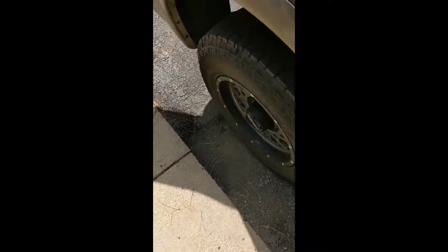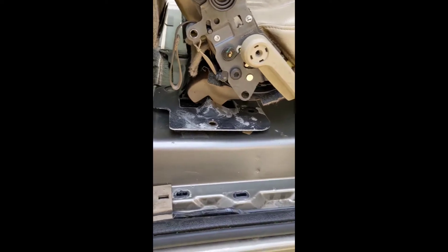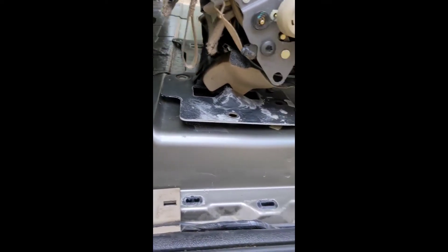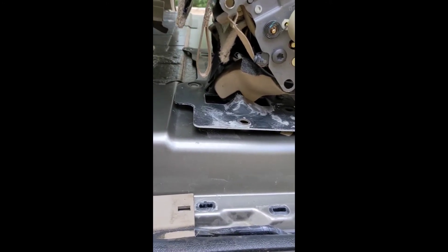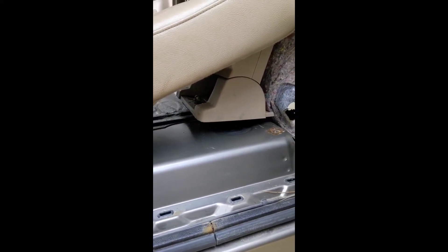I have that remote plate sitting basically right where I hoped it would. So I think what I'm gonna do is check that child safety seat and just make sure there's clearance there. And then if that clears, I'm gonna drill holes for this rear plate and get that bolted down. That way I can get this front bolted down too. The only thing I'm concerned about up here is there's this giant plastic plug, and depending on where things fall, one of my mount holes could end up right on that — which is not what I want. There are three more holes in this base plate up here, but I'd prefer to use all four if possible.